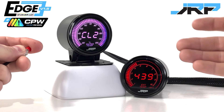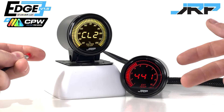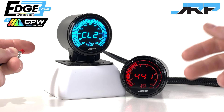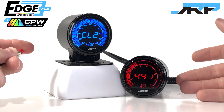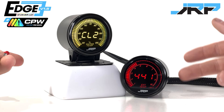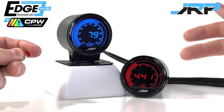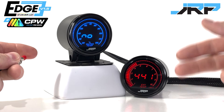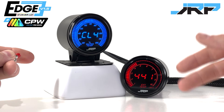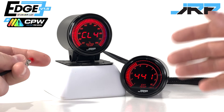We will start with the colours first. Navigate to CL2 in the menu, and hold to select. The default colour is yellow, but of course, you're free to customise this with any colour that you desire. Once chosen, wait for the gauges to display live temperature, and your changes will be saved. You can then go through the menu and make changes to CL3 and CL4 in the same way. Note that the default colours will be orange and red, but you can change this to whatever colour you want.